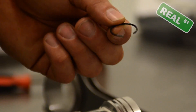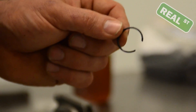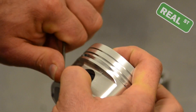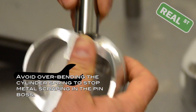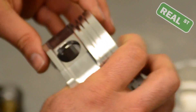When you're working with these circlips, a couple little tips. Inevitably you're going to shoot one of these things across the room and you're going to have to go look for it — it's just part of the game if you're not careful. You want to put the circlip about halfway into the pin bore, then use your thumb and this little angled pick to roll the edge in slowly. Once I have it about halfway in, I'll just use the pin and I can just seat it right in — you hear it click. So this is good to go.